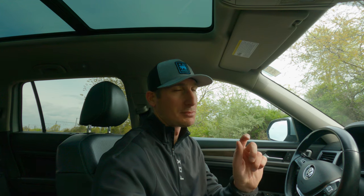I was surprised. The only thing about that is the rebound, there's no clicks, it's just a smooth dial, so you have to fine tune it where you need it. So that's the only downfall on the fork itself. Tires are great, holy smokes. The one thing I would recommend is running a CushCore in the rear, so that way, depending on your weight, you can get down to like 18, 19 PSI, so it's a little bit more cushion in the rear, because it's a hardtail.